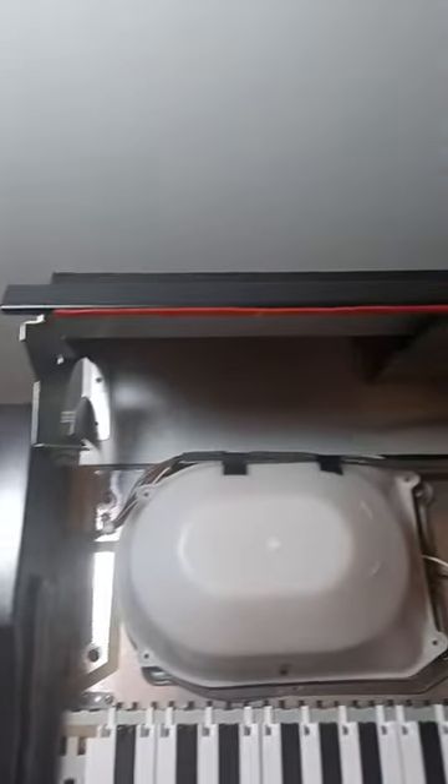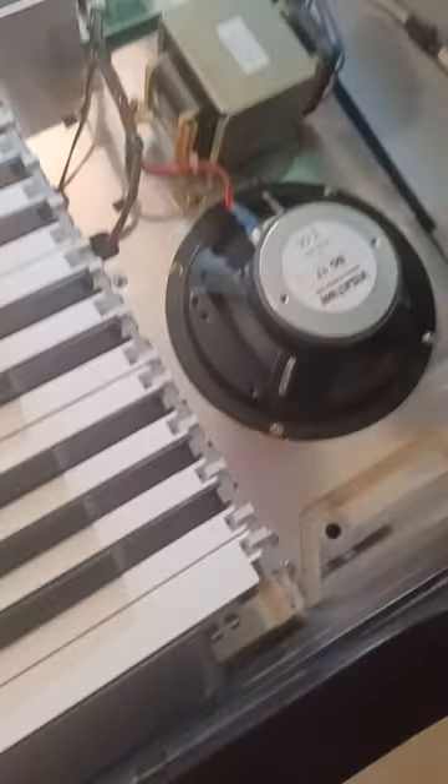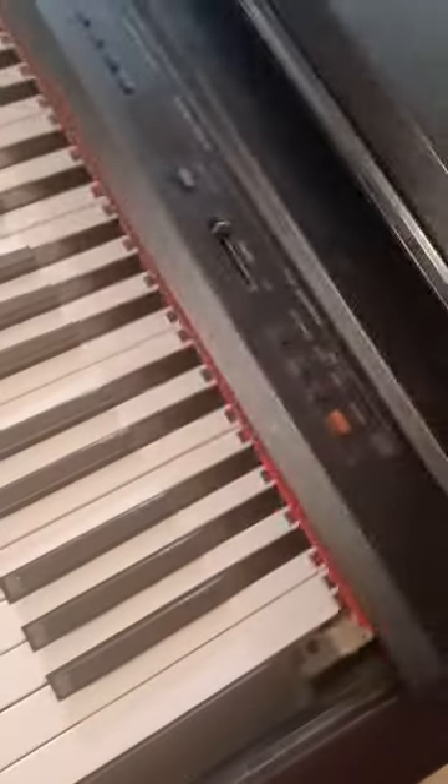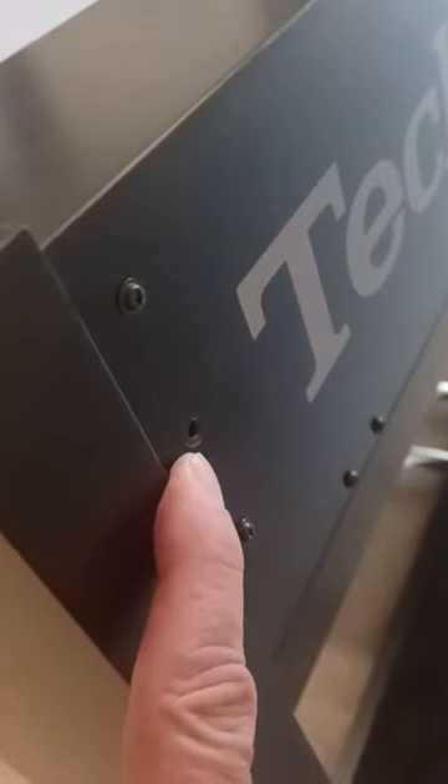This top is just a cover for the speaker — it hinges back. If you grab it, there are a couple of piano hinges in the back. There are four screws you have to remove: one is right down here, one on the opposing side, and two in the back. Right here — that middle one on both ends, that one and the one on the far end.